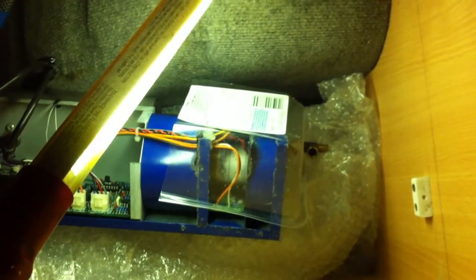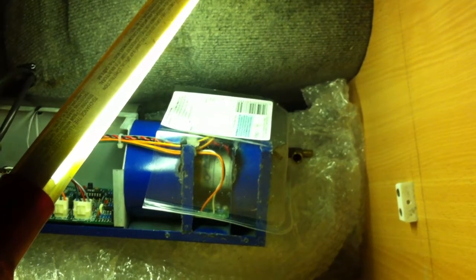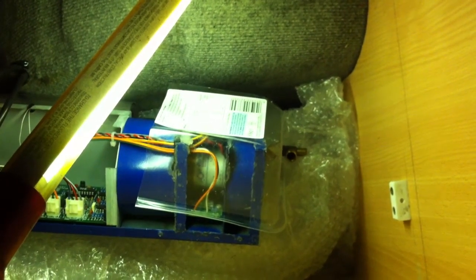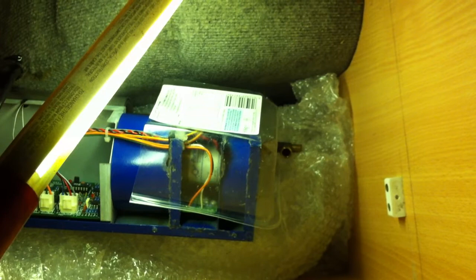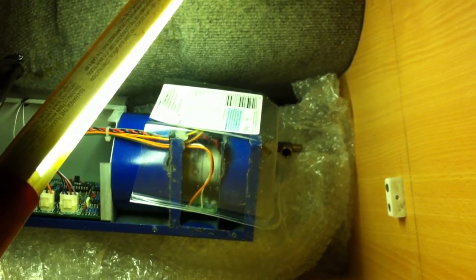Here's my test just to make sure that the fan is actually spinning. What I've done so I can see that it's working is I've just plugged it back in — I've got no gas connection — and I've used some clear food packaging which I've just cut with some scissors to place over the motor to make it semi airtight so that I can see the black and white stripes spinning on the fan.